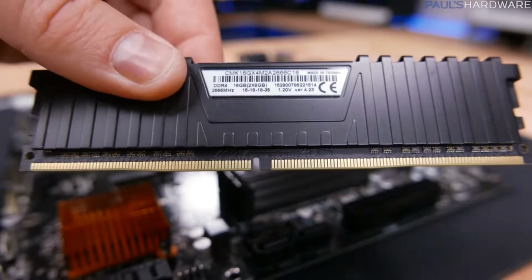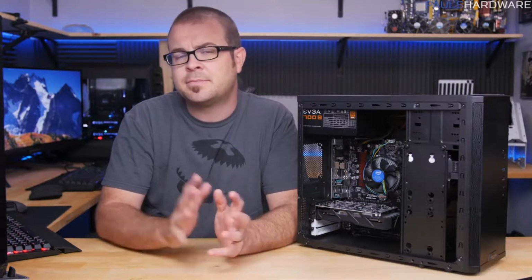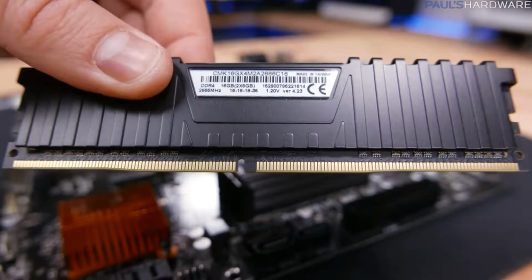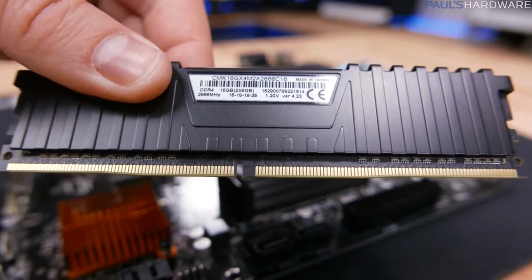Next is memory. I have 1 stick and 4 slots, and the manual doesn't really say which slot to use for a single stick. Oh well, that's fine. I'm just going to go with the outer one, and it is easy to move a stick of memory if it doesn't happen to work. FYI, it did. The memory sticks have a notch in the middle that's just off center, so just make sure you've got it flipped the right way.